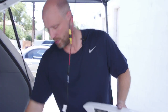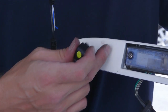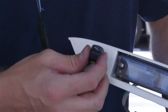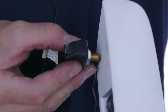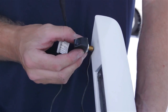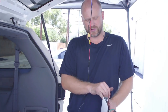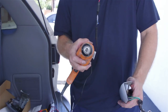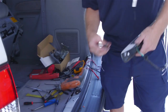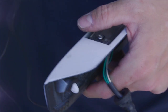Now we're getting ready to install the camera. The type of camera we're going to use is what is known as a surface mount camera — this one has a recessed nut, though sometimes others have brackets. The intent is to basically recess the body of the camera or a portion of it, which retains the camera, looks OEM, and is super easy to install. The way we're going to drill this is with a unibit — this multi-step bit drills plastic really nicely and easily without catching and pulling the drill. We've gone ahead and marked using a scratch awl exactly where we want to mount the camera, and now we'll go ahead and drill it.